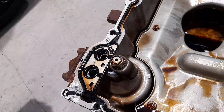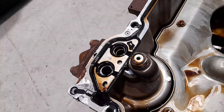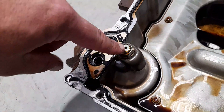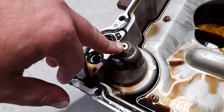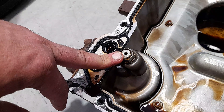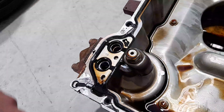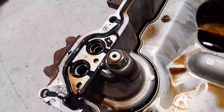We're putting a cam in it, changing the oil pump, removing the AFM/DOD lifters and so on. I will remove this valve and screw a plug into it so it cannot drop the oil pressure, because that limits your oil pressure to about 55 to 60 psi - once it hits that, it starts dumping oil back into the sump. So yeah, that will get removed.